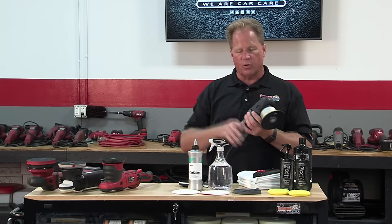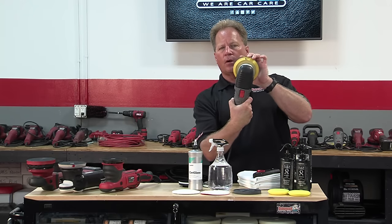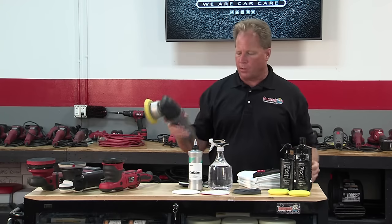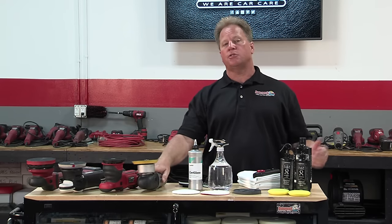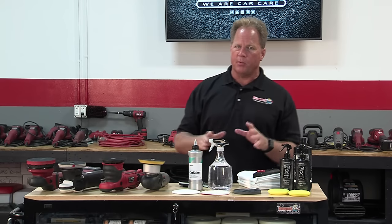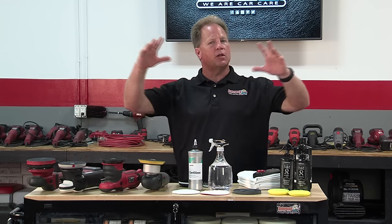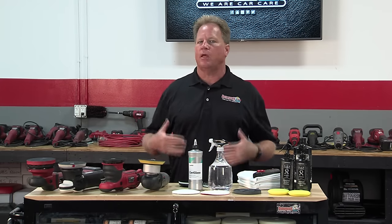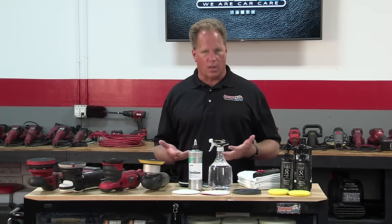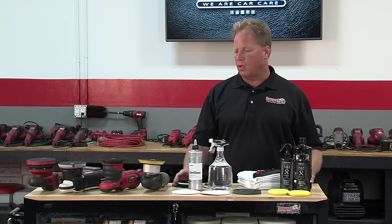But I thought, if you put that pad on there, mark your backing plate with a felt marker, and then maintain pad rotation, isn't it, in a way, doing the same thing? And my little brain said, why, yes it is. So I went out and tried it and it worked just fine. I did that because I knew a lot of people didn't own a rotary, but a lot of people owned things like this. And so it opened up the world of glass polishing to anybody with any kind of orbital polisher. That article probably dates back about 8 years ago. So I've been doing this a long time, and you can use any tool.